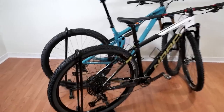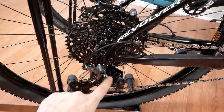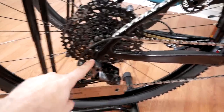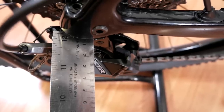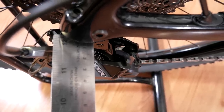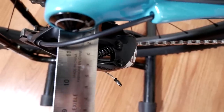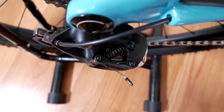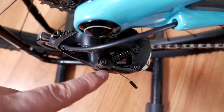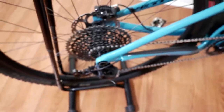There's one more question I'm going to try to answer, and that is how far out does the derailleur come from the frame. Measuring from the actual derailleur hanger, this XTR is about 28 mm, or almost 3 cm. As opposed to that, this SRAM Eagle X01 is about 4 cm. So that's at least an extra centimeter that the SRAM Eagle sticks out from the frame.